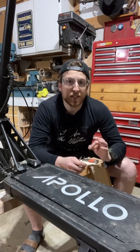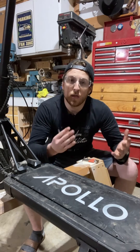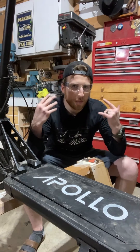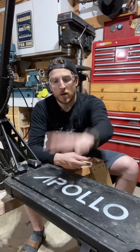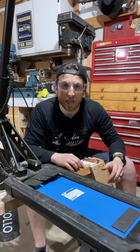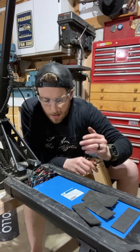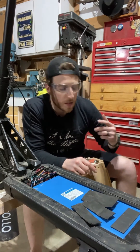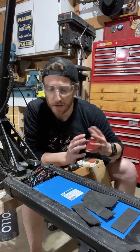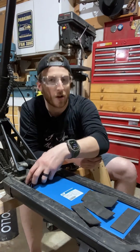Long story short, I got an EE-06 troubleshoot code, which has to do with the battery, and so I figured it'd be good to go through the troubleshooting process to understand where I think of things as an electrician. I'm going to take the cover off first and foremost, and let me just say they pack this stuff in here tight. Here we've got a bird's nest of a harness, and taking the cover off, I can already smell something, which is an indicator that something has burned. So I'm going to be checking the leads, make sure that there's no shorts, and I'm going to be checking the battery as well because that's the error code that I got.